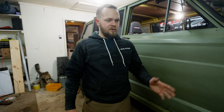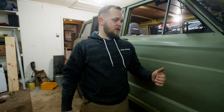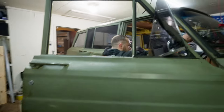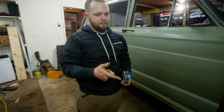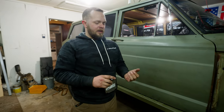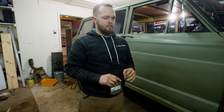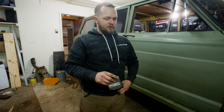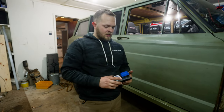That will be going in here soon and I'm also working on the harness. In order to run the transmission behind an all-mechanical motor, you have to have input of a throttle position sensor and RPM signal — those are the two biggest things the transmission needs to work. You still have the TCM, so you can't get rid of it like you can on a 4L80 or something, but you can run a standalone harness.